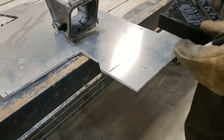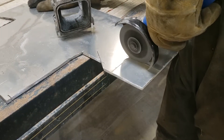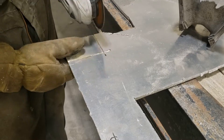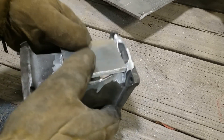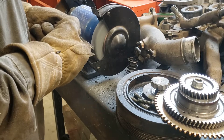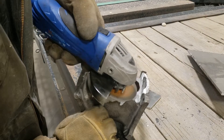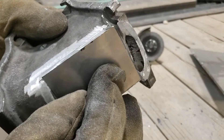To make the plate, I'll start by cutting out a rough square close in size from the quarter-inch aluminum sheet. Once cut, I can mock it up onto the Y-bridge, mark out the pieces that hang over and the parts that don't fit flush, then clean it up and trim it down so it fits perfectly with no gaps for the welding process later on.